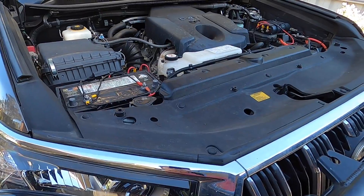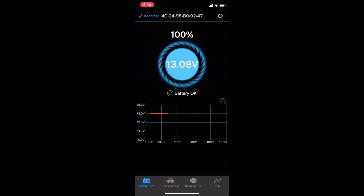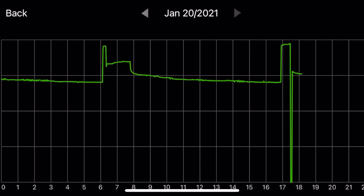Fridge is in the back of the Prado now, brake is on and it's started. You can see it's sitting on 13.07 volts so it's fully charged at 100% - it had a good hour drive today and a three or four hour drive a couple of days ago. Going into the trends, you can see the battery is holding pretty steady. It was charging this afternoon at that 14.7 to 14.8 volt mark, then peaked out and came back down to 13 volts on float charge, trending nicely at about 12.8 to 12.9 volts when it hasn't been driving.